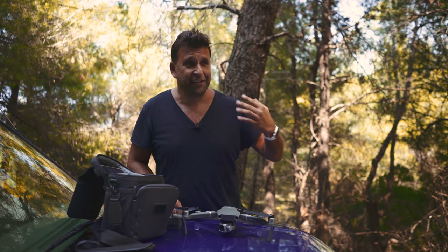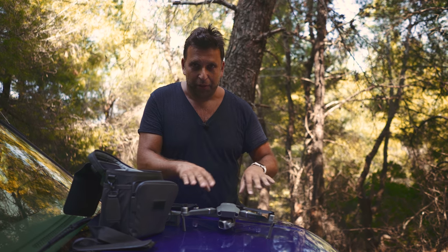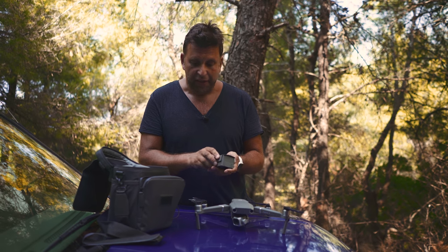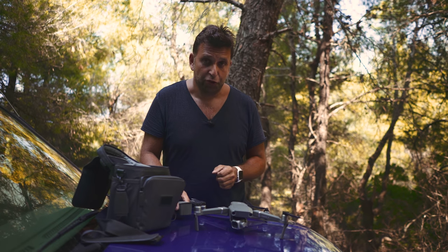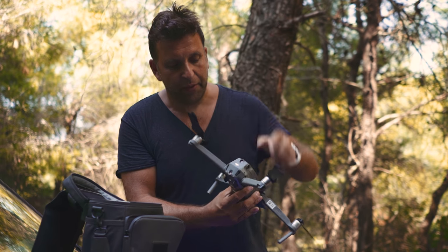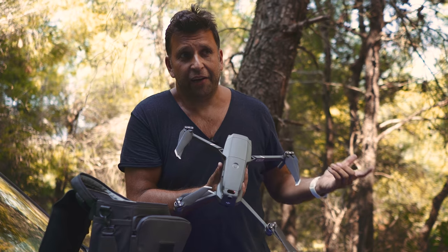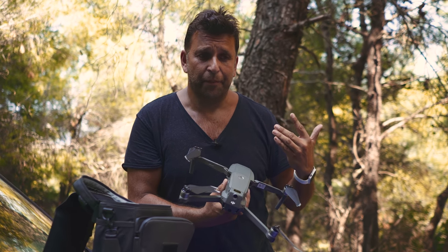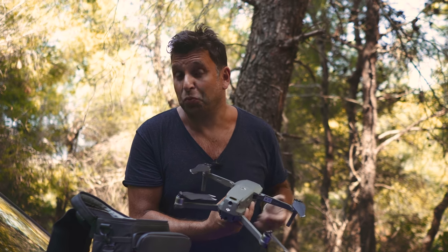I've accidentally had two not-perfect landings and it's been completely fine — the drone is spotless. It feels very solid. Battery life definitely seems to last longer, which is nice, but it's still not enough — I need another two. There are sensors all around. Many only work in autonomous modes. I've noticed the app keeps saying side sensors aren't working in normal flying mode, but they are there. There are two at the front, two at the back, underneath, and one at the top. Flying under trees in tripod mode, it gave proximity warnings — you have to turn off obstacle avoidance for really close shots, but it's nice to know how close you are.